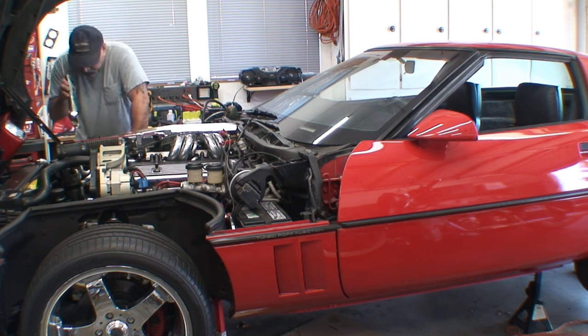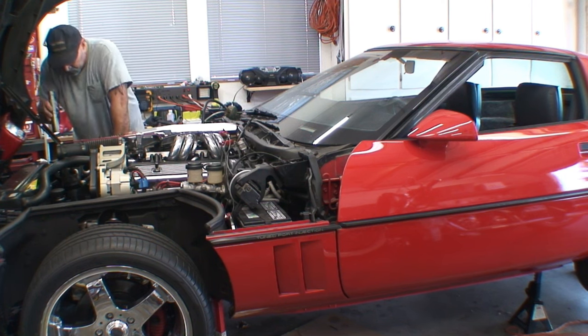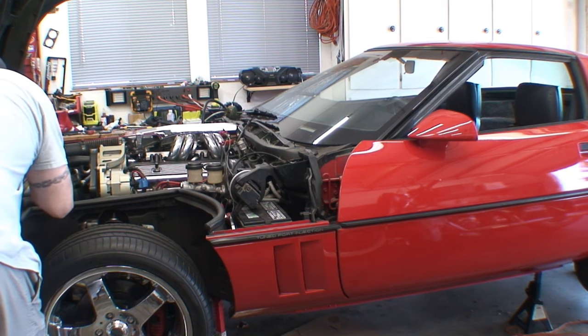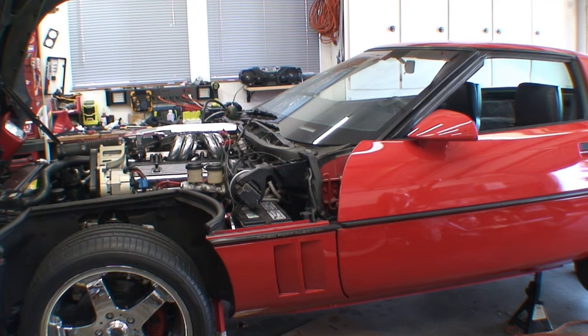When you try to track down issues like this, I knew it was a fuel issue and I knew it was a vacuum issue. You're looking for everything — vacuum hoses, fuel injectors, pulling your spark plugs and checking them, anything and everything. When you put things back together, things can happen. In this case, even though I adjusted the fuel pressure regulator close enough, the no-fuel issue turned out to be a blown fuse for the fuel pump. The fuel pressure regulator had the brass fitting pop off, and I also found another hose that wasn't connected — there was my vacuum leak.